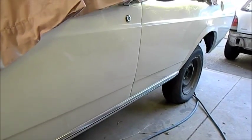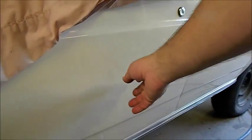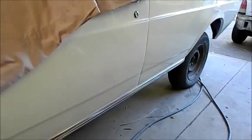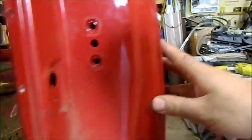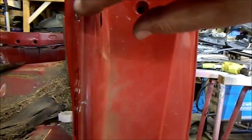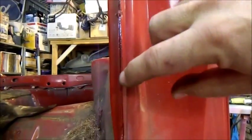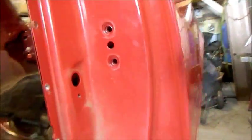Now in these cars, the body sheet metal is 1mm thick, and you've got to be careful if you're welding a patch in anywhere down the bottom or whatever. Very, very easy to get too much heat into the panel and warp and twist it and so forth. Now the problem we have with this, it's not just mine, it's Charlie's as well, is this is much, much thinner sheet metal. And if you look at the profile of it, there's triple skin there. The middle one is a good millimetre thick. The inner and outer ones are thinner. And the outer one only looks to be 0.6 or 0.8.